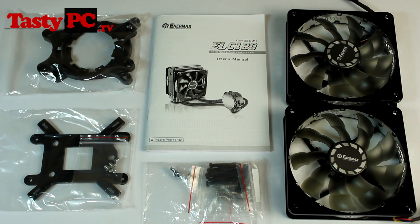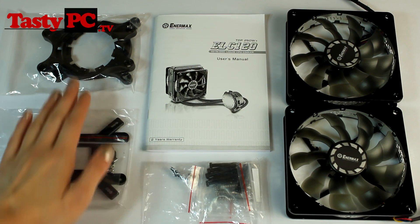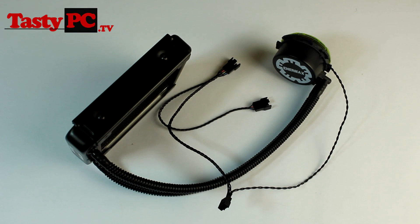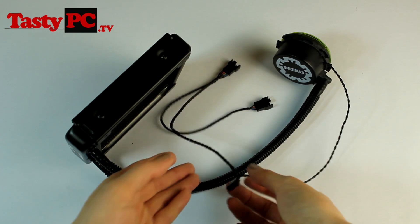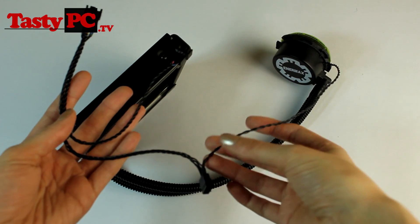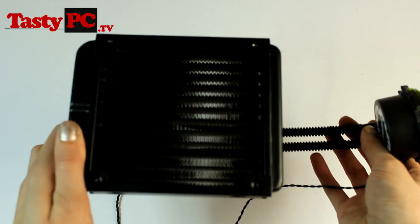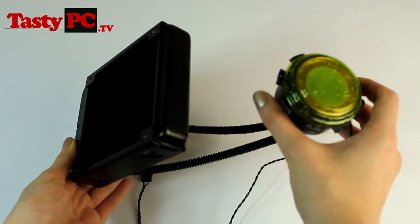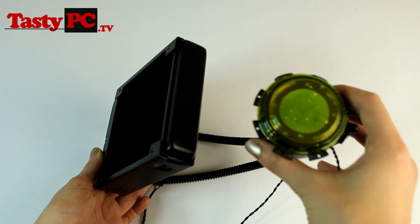Now I'm going to show you what comes inside the box. You get a user manual, the two fans, and all the fitting screws, backplates, and mounts you need to fit this to both AMD and Intel CPUs in either push or pull configuration. And then lastly you've got the ELC120 itself. It offers all the features you'd expect with plastic flexible tubing that pivots. I really love how the cooler is powered — everything runs on a single cable in a logical order and you can plug the three-pin into your motherboard and tuck the two connectors behind your motherboard tray. The radiator build quality is much better than I expected — pretty much flawless. The base of the CPU block has already been pre-applied with thermal paste, which is definitely a positive for beginners.